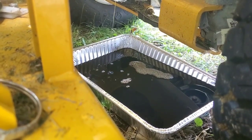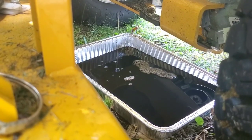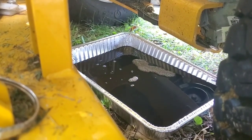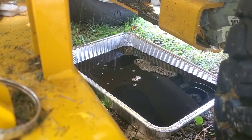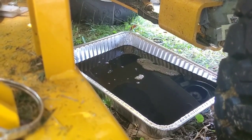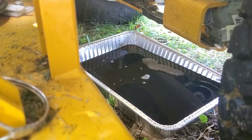But something you wanna do every 50 hours, if you're a homeowner, you can replace the oil every 50 hours and the oil filter every 100 hours, totally up to you. If I'm going as far as doing this, I'll spend $10, $12 on an oil filter. It just gives you some extra peace of mind and a little bit better for your motor, all right? But do what you want to do, of course. But if you're running it commercially, every 50 hours would probably be the best way to do it, all right?